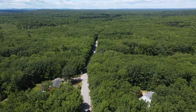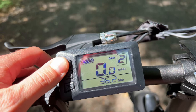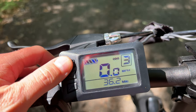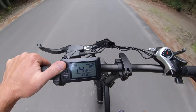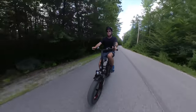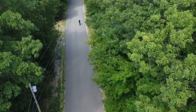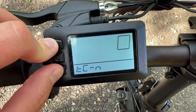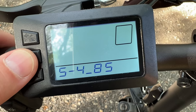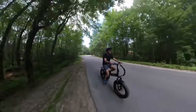The display gives you all the information you need in a crisp backlit screen. Buttons allow you to switch between the different levels of pedal assistance. By default there are four levels: zero is no assistance, one is around 10 miles an hour, two is 15, and three is top speed at 20 miles an hour on a flat road. Once you start pedaling, the motor ramps in smoothly to give you a boost. I found the 500 watt motor to be quiet and responsive with lots of torque and quick acceleration. Level one gives you enough power to offset the weight and make it a little easier than a normal bike. Level two makes you feel like Lance Armstrong, all juiced up. And level three makes you feel like a superhero with endless power and stamina. The pedal assist levels are completely configurable — by long pressing on the top and bottom buttons, you can enter settings and choose how many levels you want and the exact amount of power for each. I chose to modify mine to have steps zero through five for more granularity and a slower first step for getting started without too much torque.